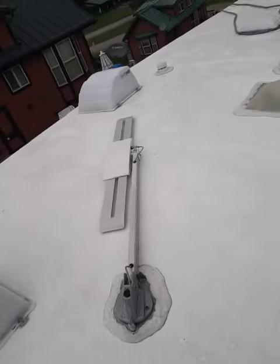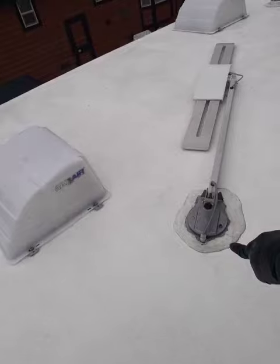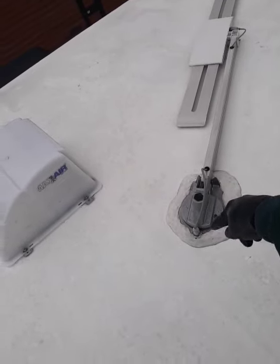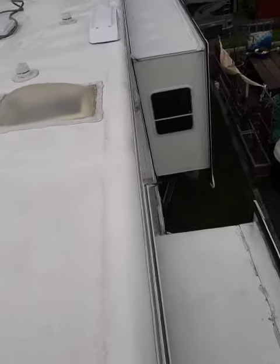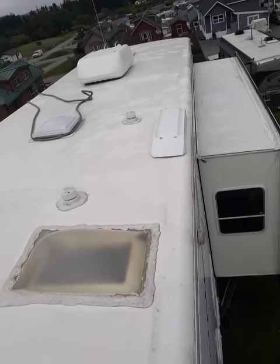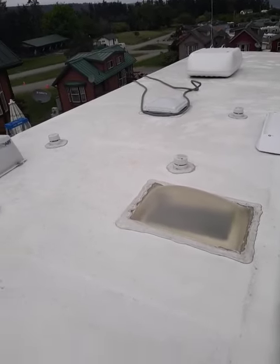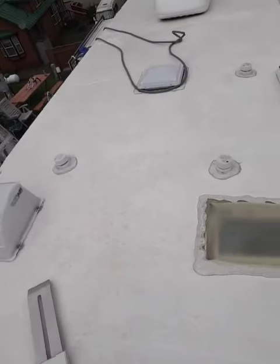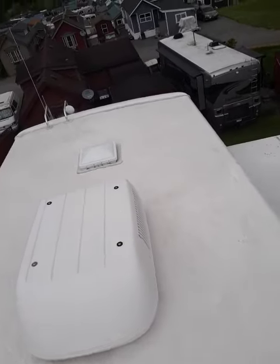You need to put a UV protection on your roof once a year too, and I'm going to be putting one on here. It takes time and you have to do it right — you put it on every single thing: all the fixtures, all the moldings that hold on to the fixtures, all the way down through the sides. Protect the roof, otherwise it gets brittle and starts to crack. Washing it and putting UV protection on your roof once a year is absolutely necessary, because of both the mold and the sun damage. If you can avoid parking your motorhome under a tree, do it, because that causes even more damage.